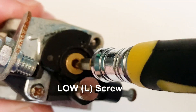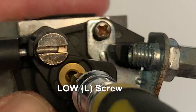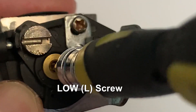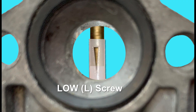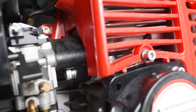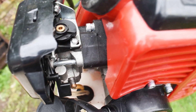To adjust this screw you need a much narrower flat screwdriver. But if you do feel that you need to adjust it and you want to save time and money by adjusting it yourself, I will show you how to do this. I will also show how this screw alters the air-to-fuel mix and the effects that has on the engine. I have this type of carburetor on my weed eater, so we'll go ahead and start the engine and make the adjustments.